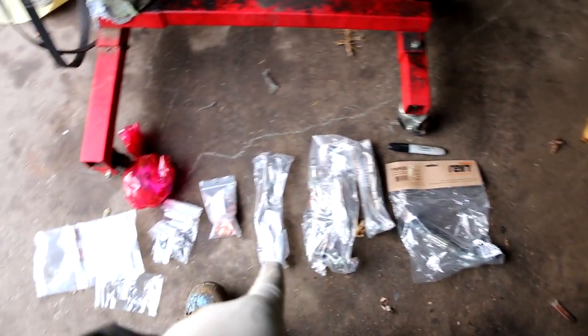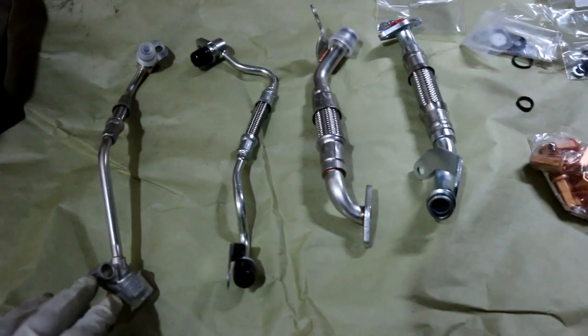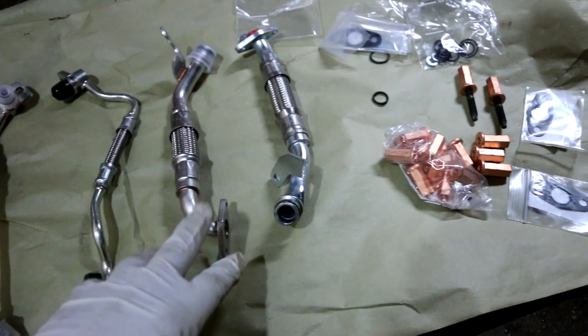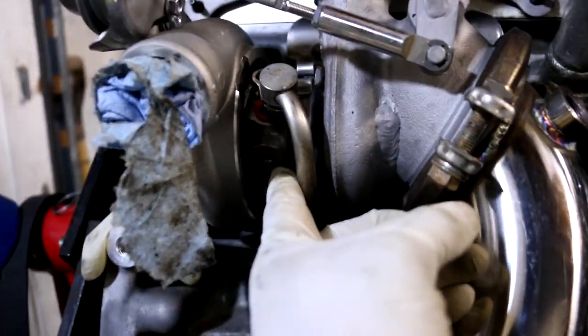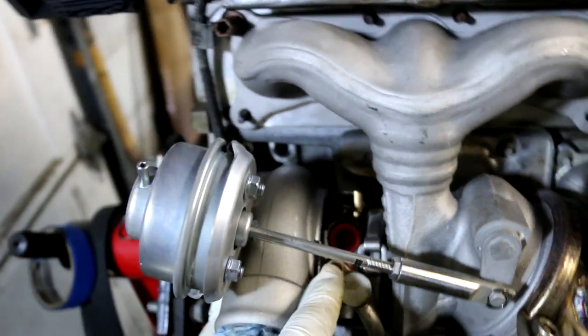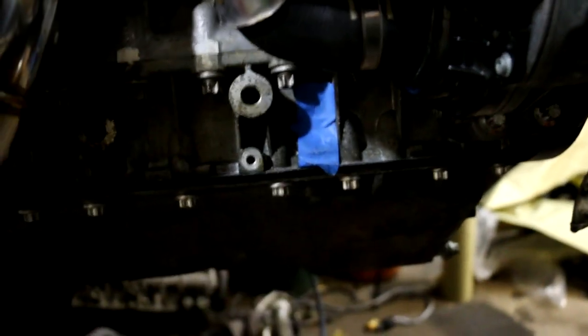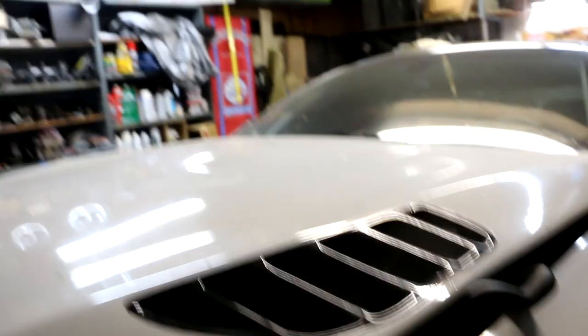On the floor here we have some drain lines and some feed lines — the skinny lines are the feeds and the larger ones are the drains. I got some new hardware, o-rings, gaskets, and torque specs. I still have to connect the drain down to where the blue tape is, and connect the feed which goes into that hole and up to the top of the turbo. Same thing on this side — feed up top and the drain is covered with blue tape.